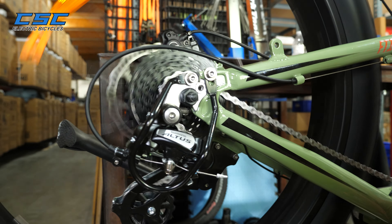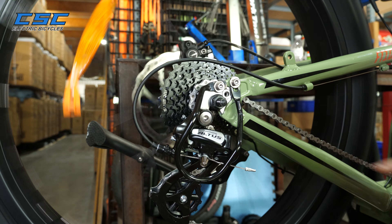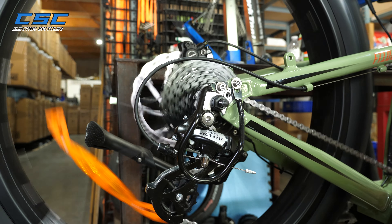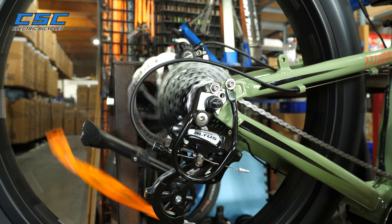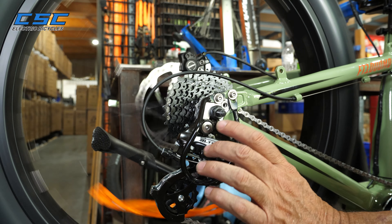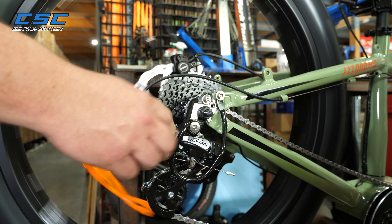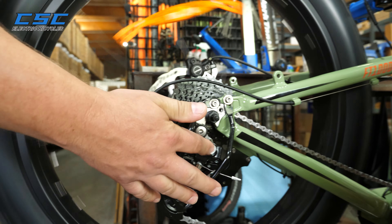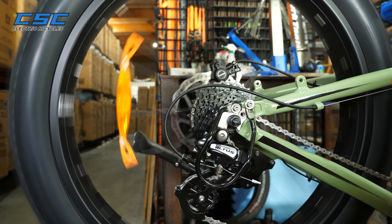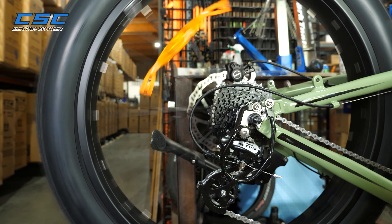It's an easy fix — just pulling the derailleur guard out a little bit. As you can see, now it goes right there. The derailleur guard is just there so that the derailleur doesn't get damaged. It's there to protect it, but sometimes if it gets bumped it can move inward and actually hit the derailleur. If the bike falls over, all you've got to do is just pull it out a little bit and that should get you going.